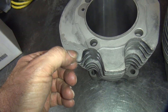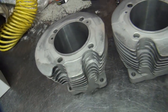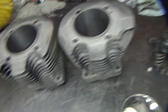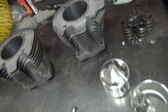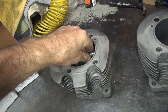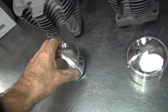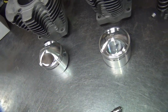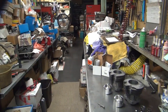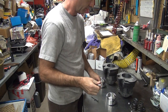This one here was welded up when I got it — it came new out of the box, but it's been welded obviously. I was trying to figure out what the hell they did. It didn't hurt the cylinder any, but now it turns out it's probably going to be a problem. See, this is the exhaust clearance that's cut in here — we have no exhaust clearance now. So we've got to see if the cylinder fits on there, which it probably won't. We determined that the rear one is the big one, front is small. So this is the big piston, this is the small piston — that's why it's got an S and a B. S&S claims their machining is so good now you don't have to measure their pistons anymore. Good joke. There's half a thou different between these two — so that's right on the money for being dead nuts perfect, right? Half a thou different.